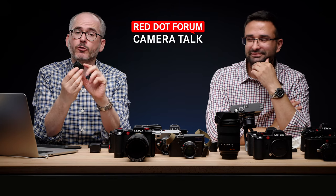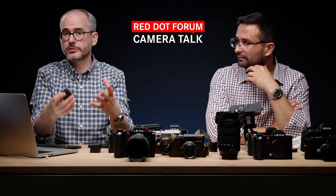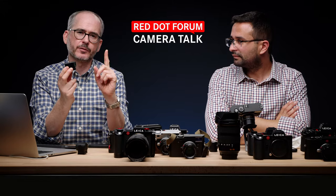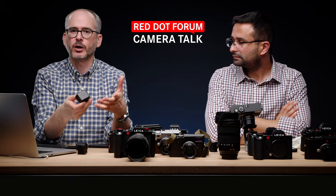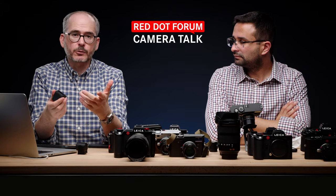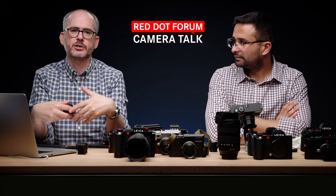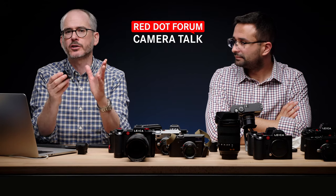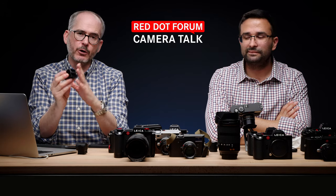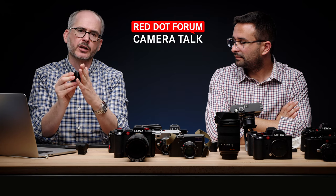So this is a 2.4 megapixel panel. And these cameras, the M10 generation, were only designed to output a 2.4 megapixel video feed. This is 3.68 megapixel resolution, which was designed from the get-go on the M11 to output here. Leica has made this compatible, which is great, with just this firmware update. But the camera still can't output more resolution than it was designed for. So it's still outputting 2.4 megapixels into the 3.68 megapixel EVF. How that materializes is the view inside here is just a little bit smaller than if you put this on an M11.